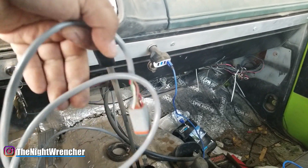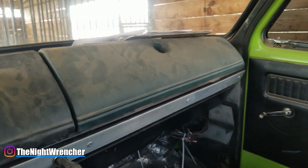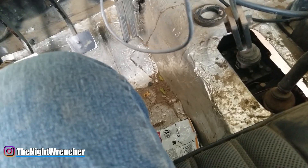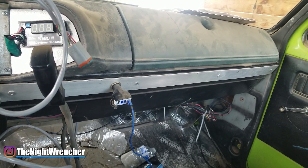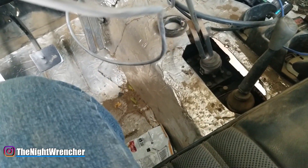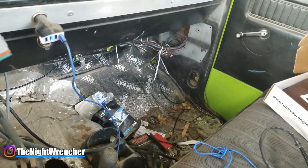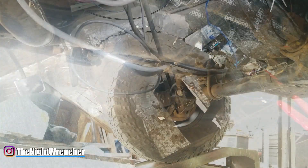The first set of wires I'm actually going to hook up are going to be the ones for the wideband O2 sensor itself. Normally I would run them across the dash, go down the side, into that hole right there, then run them back under it, jump over the transmission, and go to the exhaust pipe on my driver's side. But I don't think these wires are going to extend that far, so I'm probably going to have to run them down through the shifter hole and bypass straight to the exhaust. The reason I can't put it on the passenger side is because the hole for the wideband on the passenger side is right up against the frame and there's no room for the sensor.